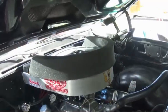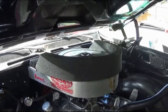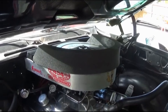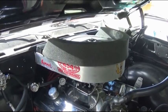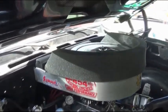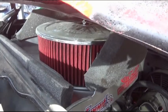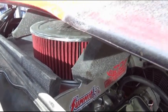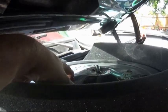Not only did this one give us hood clearance, but we're also drawing cold air from outside rather than from under here. There's a lot of heat buildup under these hoods, but a good functional cowl induction will work wonders. As you can see, the air filter opens up from the back side on this one, so all the air coming through from the windshield into the cowl is going into the air cleaner so it can suck cool fresh air into the engine.